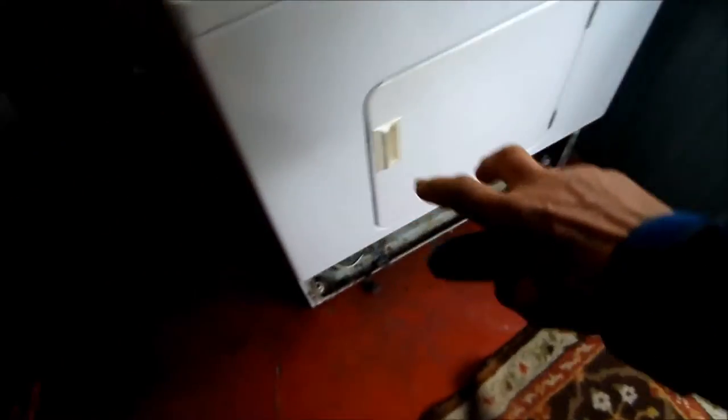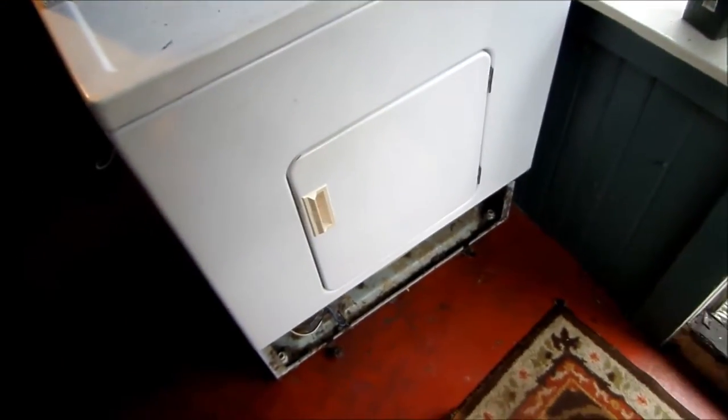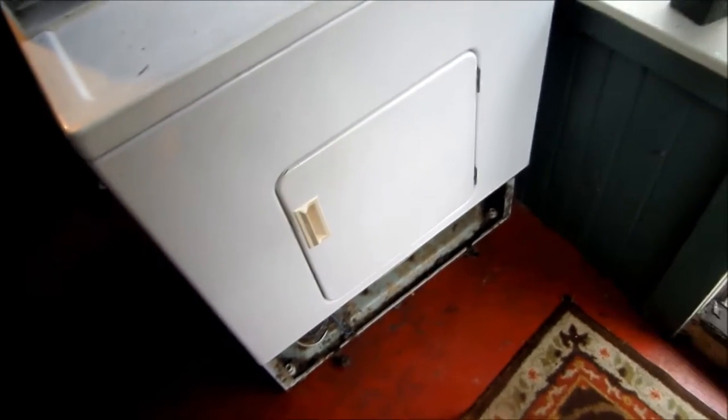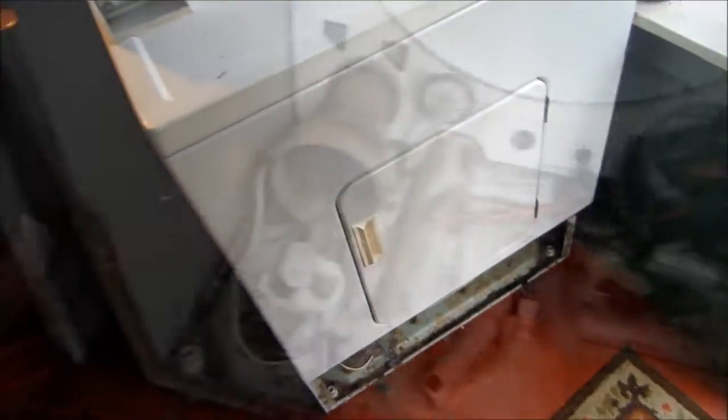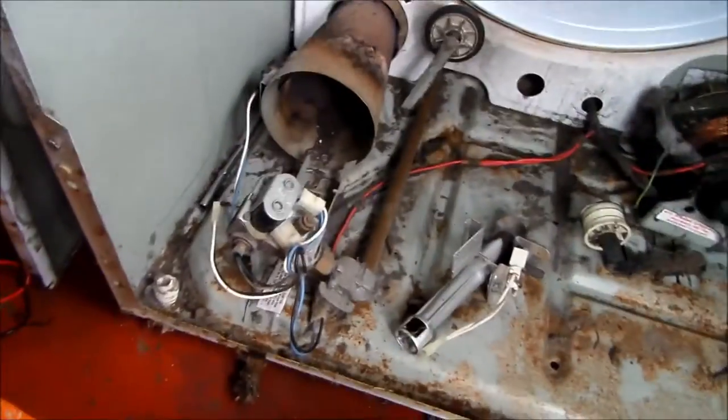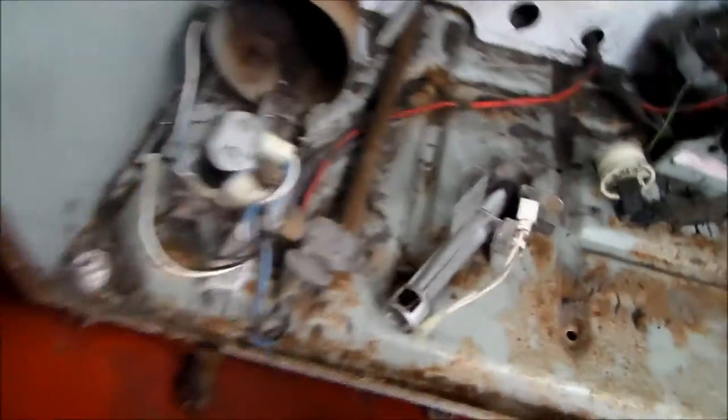That's a half-inch — you'll need a long half-inch sleeve to pull that off. Once you pull that off, you can pull the top off, then pull the front of the dryer out and get to the back. I'll also recondition the rollers and clean the machine as well. I've got the front panel off and I'm inside the machine now.